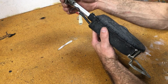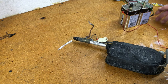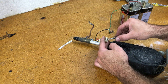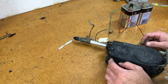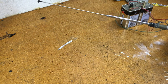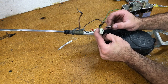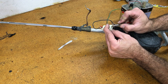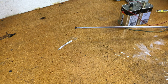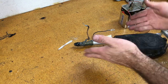So this is the old antenna. It works, but it's getting old and sometimes it binds up. So let's do a quick test here. This is your negative. You hook up your negative to this guy and then you hook up both of these guys together. Then if you want to retract it, you just press just this one and it's going down, you can see. So it works, but it binds up and I want to replace it. And I also want to teach you how to replace it.